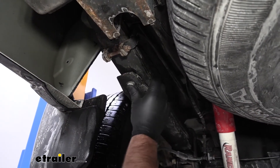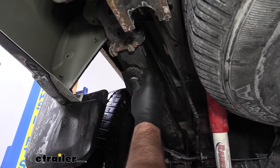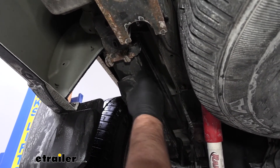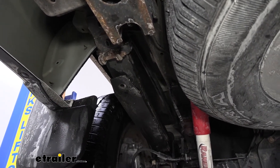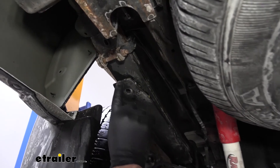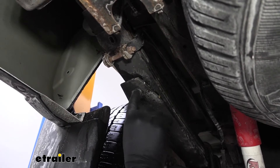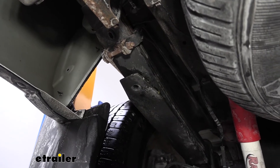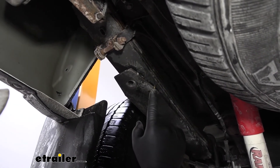So here what we are going to do is, if you have a hole, you are going to have a pad in here like this — we are going to take it and push it out. If you do not have a hole, you are going to measure an inch in from the end, use a 7/16 drill bit, center it and drill a hole there.